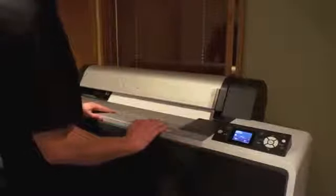Go ahead and close the top cover. Turn the suction back to the middle section — that way it'll hold it in place — and then press the upper right-hand button to close the platen gap. It's going to ask you to press the pause button. Either press the pause button, or if you wait a few seconds, it's going to automatically start preparing the paper for printing.